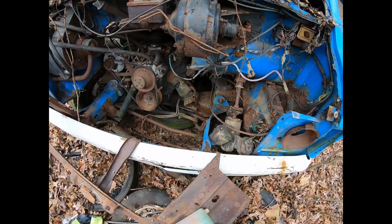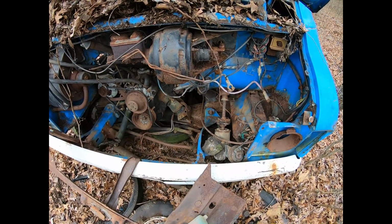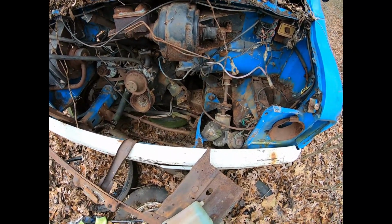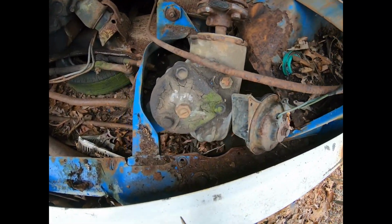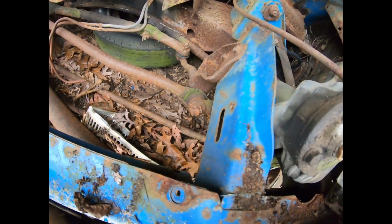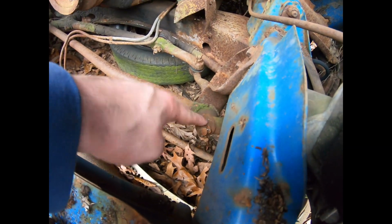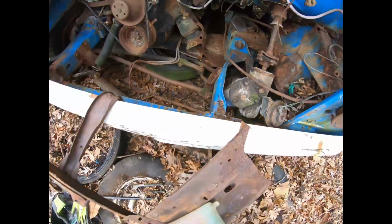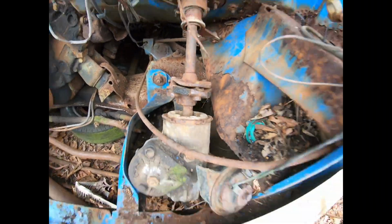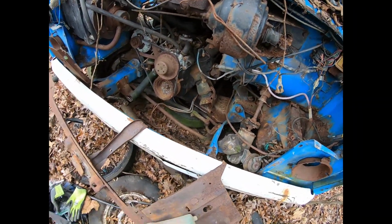But like I said, you can use a 318, small block Chrysler push rod, and you can bang it out usually. And I got all three of the bolts out, and I'm just having trouble with the, I think I neglected to bring the size to get this off, plus the cotter pin stuck in there, so I have to try to bust it off, and hopefully we can separate this section here when we're ready.